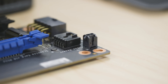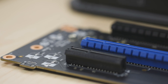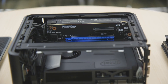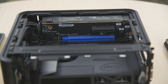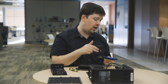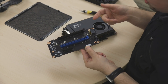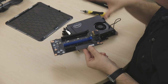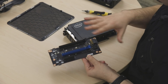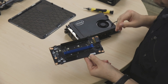That's because this computer doesn't really have another motherboard. All it has connecting the rest of the computer together is this single baseboard with a couple of PCIe X16 slots and an X4 slot over there if you want to add something extra like a video capture card instead of dedicating all 16 lanes to your graphics. As you can see, there's not a lot going on here — this is just there to connect the main pieces together. All the rest of the I/O and processing power is here in this modular, replaceable card.